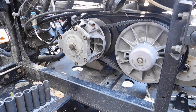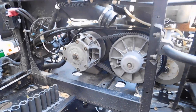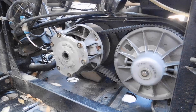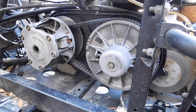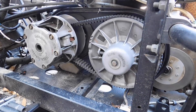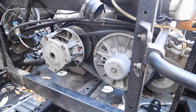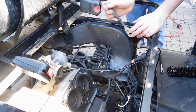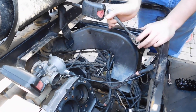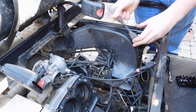Here she is. We've just got to take this big bolt off so we can separate the torque converter. We can't get this off yet, so what we're going to do is try to get the belt off — that way we can just get the engine and transaxle apart, and then we'll get this off on the table. Now we're just going to get this tube out of here. I think it's just one half-inch bolt.